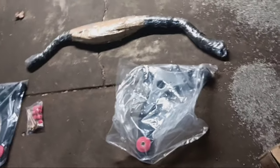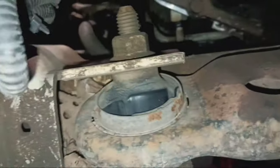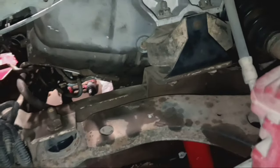I need to get the shed open, get the jack and some jack stands, get this thing in the air on jack stands, and get the front wheels off. Car's up on jack stands with the wheels off. You can see the lower control arm bushings — they're pretty cracked, looks like there's space in there. This side doesn't look horrible, but something somewhere is definitely shifting. Every time I hit the brakes, the steering wheel turns — it's crazy how bad it is.